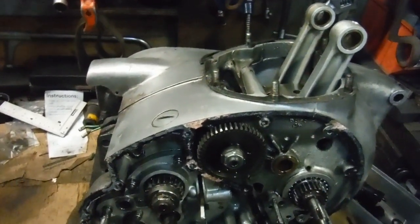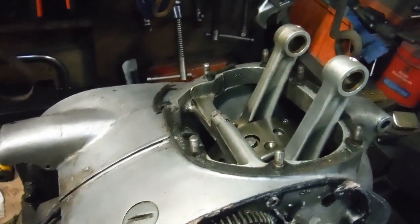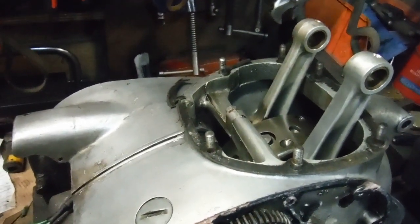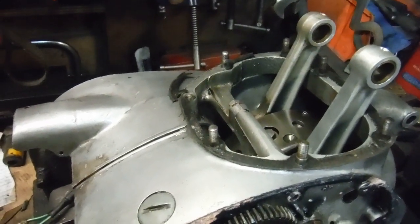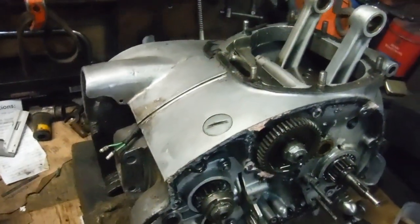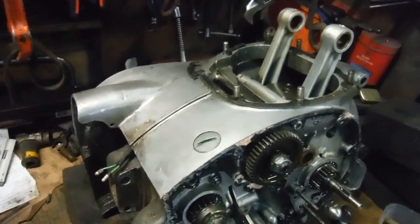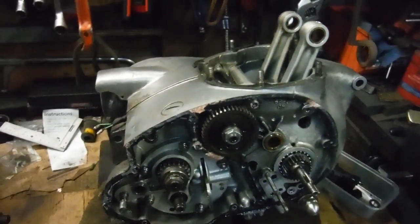A lot of the time, on many occasions when I've pulled engines apart like this, metal from the big end shells has got itself stuck to a journal rather than gouging a journal out. So that all remains to be seen though. That's just speculation at the moment, and hopefully we'll have the third exciting instalment for everyone to see fairly soon.